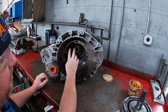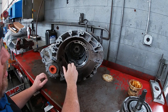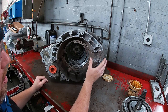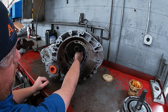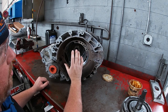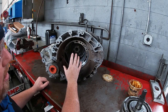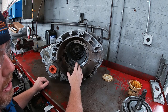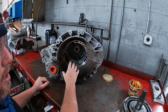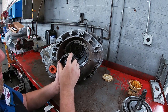What we have left to do is start inspecting the planetary gear set and the braking clutches. To get to those we have to take out the valve body and the back cover. We'll probably leave the low reverse piston in the back still in the case. Taking the valve body off will gain us access to the two-four piston. There's a little transfer tube that has to come out to pull the piston out, and also to get the braking clutches out. The braking clutches hold a member of the planetary gear set to prevent it from turning while the apply clutch applies to another member, and the third member is the output.